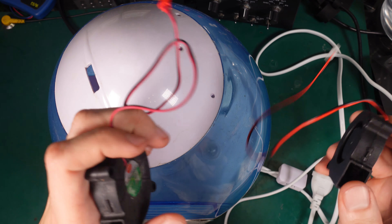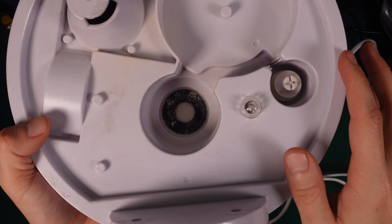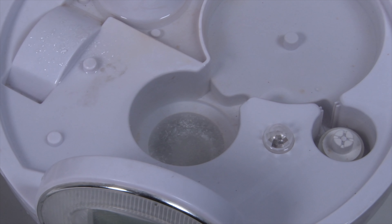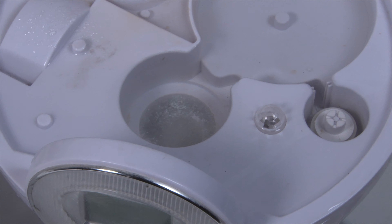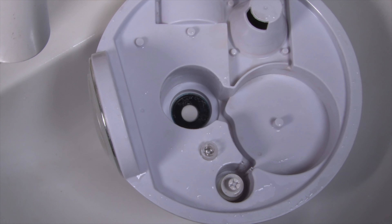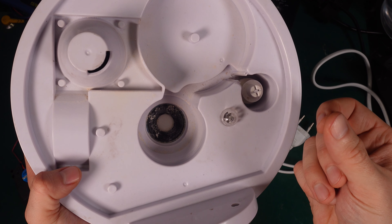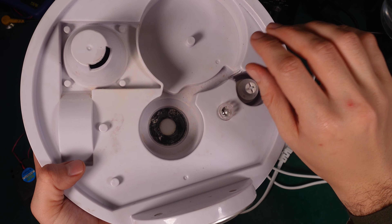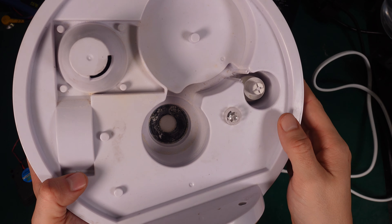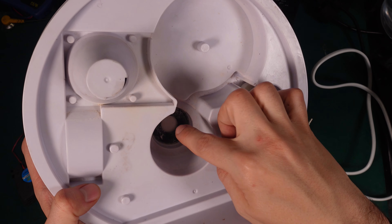What are the most common problems? First of all, as you can see, there is a lot of lime scale. To remove it, I usually use citric acid, food grade — I pour it with some water and it's going to be completely dissolved. If it doesn't work after that, grab your finger and touch the element. If you can feel something like an oil, that's most likely because someone poured an essential oil and it attached to the element, preventing mist production. In that case, you have to use isopropyl alcohol to clean it out.